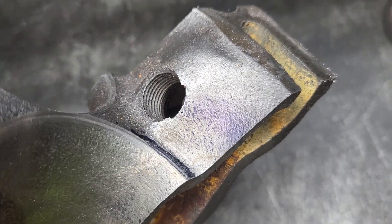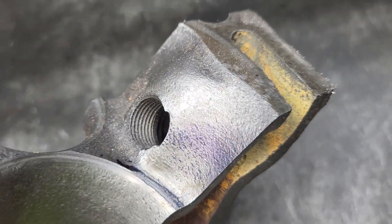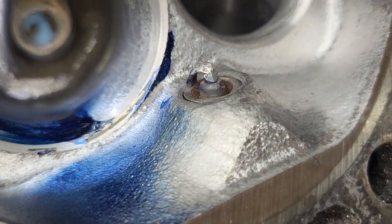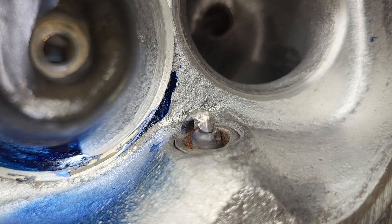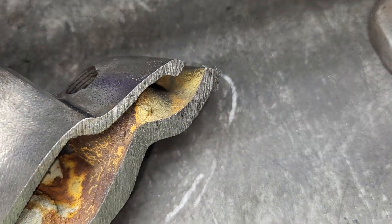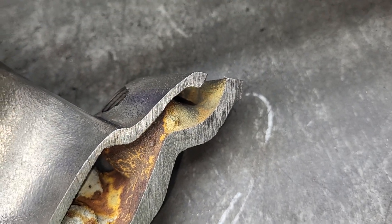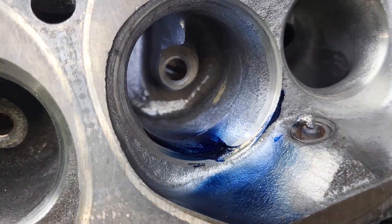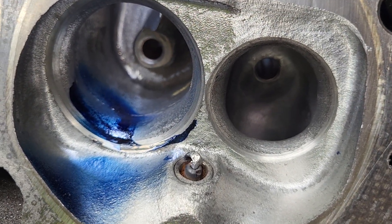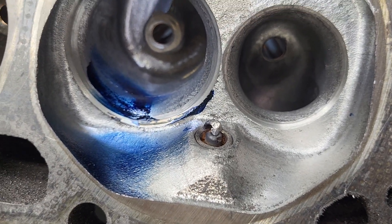Right here by our plug, I took a little extra metal out because I can get some extra flow. I didn't take nearly as much off around here — I'd like a nice amount of metal all the way around that plug boss. You can see how thin that is — that's less than 100 thousandths. That's kind of pushing your luck as far as I'm concerned. As far as we can see on the liquid inside the bowl and on the chamber, it's not bad where it is.